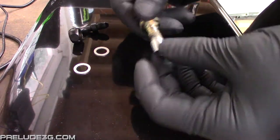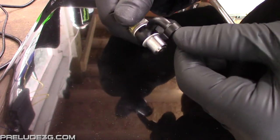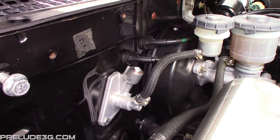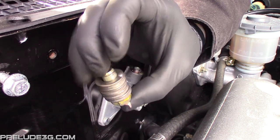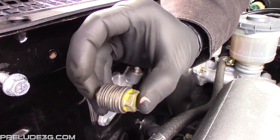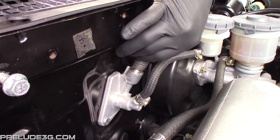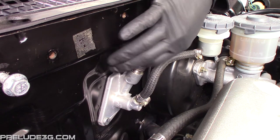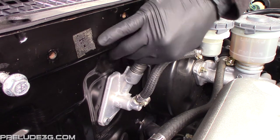Here's an example how the master cylinder side is going to look with that thread adapter. It gets a little tricky trying to get the adapter threaded into the master cylinder. I ended up sticking a bunch of washers onto the bolt, then the adapter. That lets me thread the adapter all the way in without the bolt bottoming out. I was able to unscrew the bolt without the adapter coming back out with it, but if it won't stay in place, you might try using some Loctite to keep it in there.